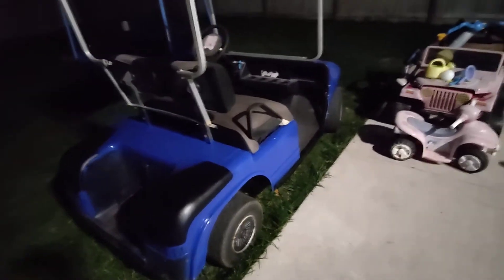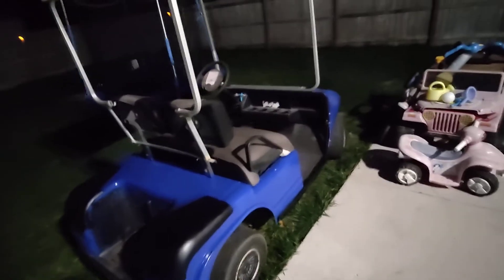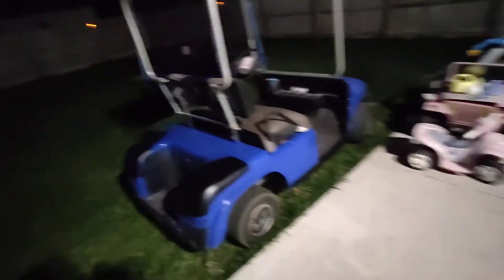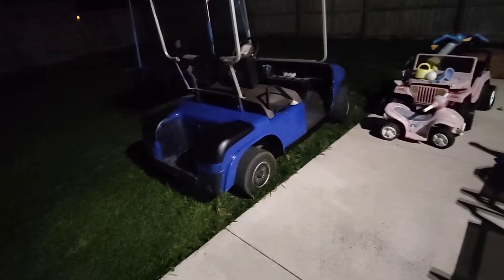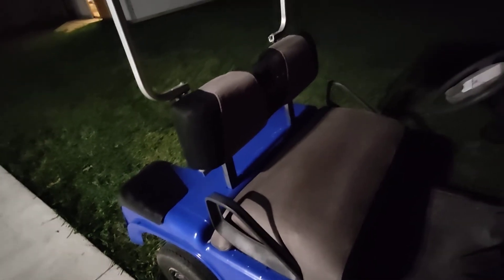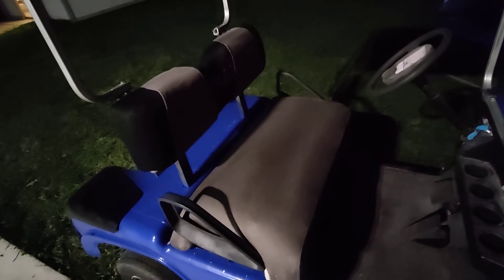The next part was the brake lines — the actual link cables to the front. They were so rusted in their sheaths that when I put on one, it actually broke in half, and the other one was rusted in place and I had to angle grind it out of there. I ended up trying to part-match but ended up with Club Car brake cables. They're four inches longer, but I was able to modify the linkages to function with them.